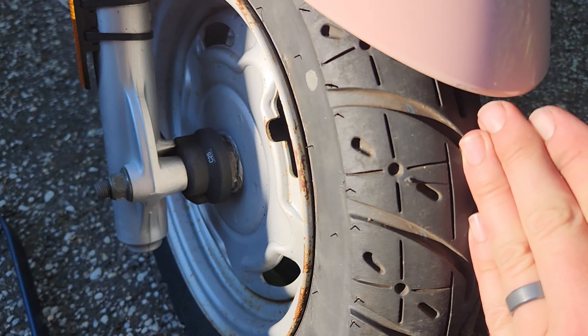Learn from my mistake. This is set — let's go ahead and fill it with air. 22 PSI in the front and 25 PSI in the rear, and we are squared away. Relatively simple to do, didn't take any real specialty tools or anything. Go ahead and replace your valve stems as you replace your tires — learn from my mistake. This is Outside the Target Demographic. I appreciate you guys stopping by. Any questions, comments, or concerns, leave them in the comments section down below and I'll catch you guys in the next video.